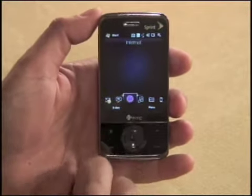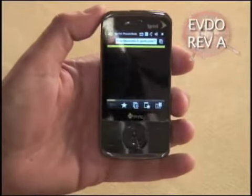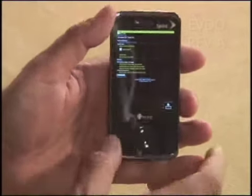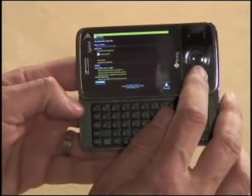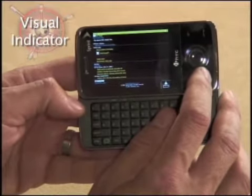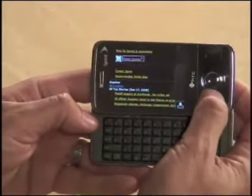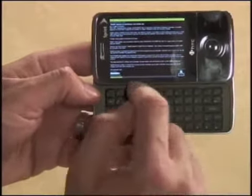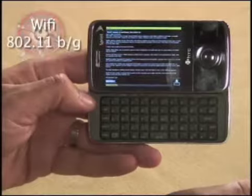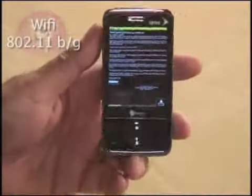The internet on this is really cool. It uses the Opera Mini browser. The phone works on the Sprint 3G network — specifically the Sprint EVDO Rev-A. If I turn it sideways, the accelerometer kicks in and the phone changes orientation, and then when I pop it open I can use the keyboard to type emails or text messages. Notice it's flashing every once in a while — it's telling me I've got a message waiting. I can rotate my finger around the selection key and it zooms into specific portions of the page, and I can use it to move around and make selections. It also works on Wi-Fi — the B and G variety — so when you're somewhere with free Wi-Fi, like a Starbucks or Panera, you can use that as well.